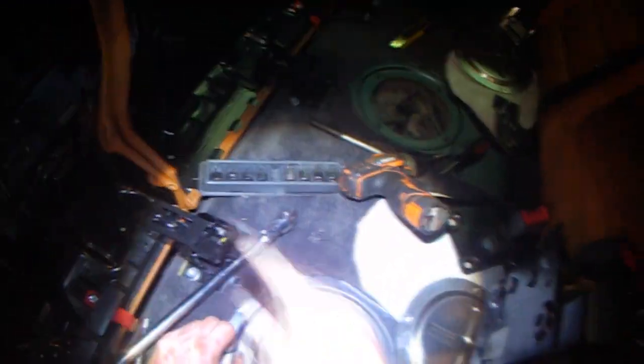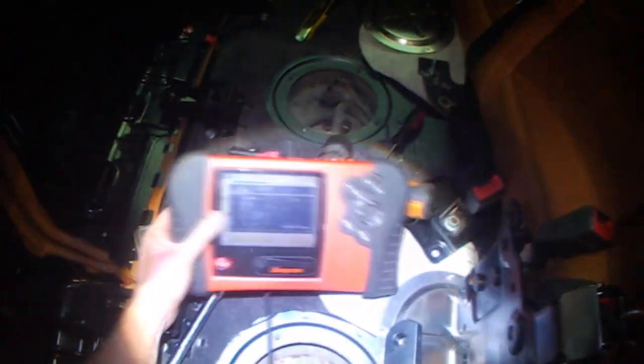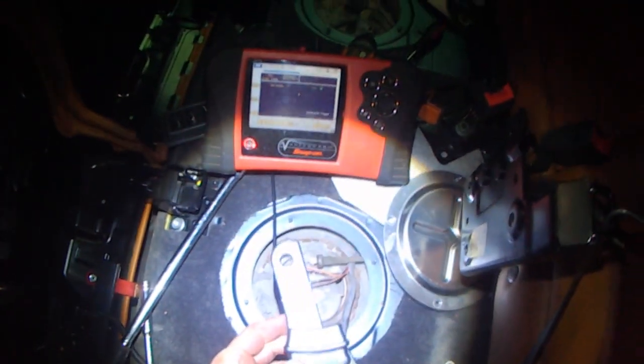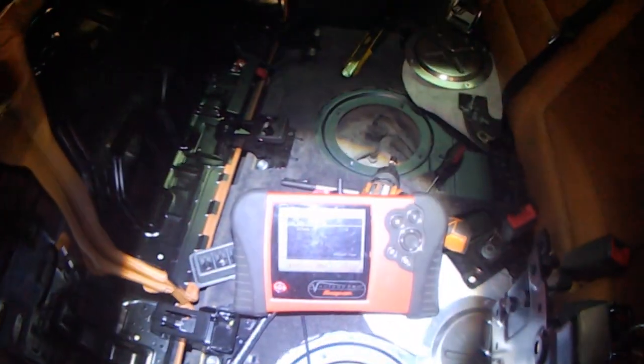You can then watch the health of the pump. It should show nice even humps, because if there are dropouts, that pump is no good. It's probably going to be too bright to see on screen, but I'm going to save the waveform so you'll see it.